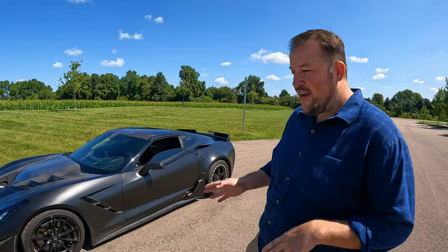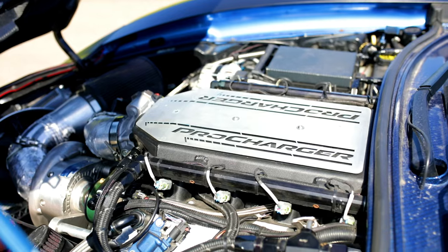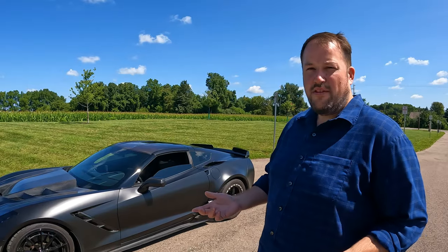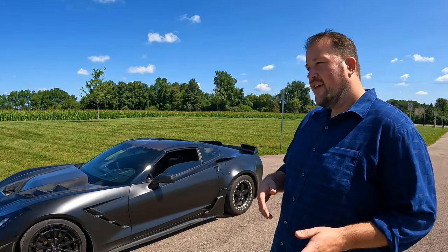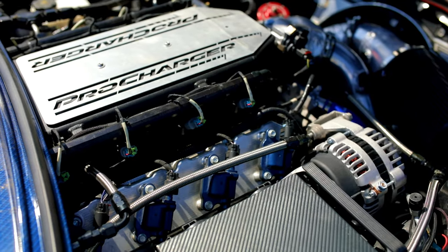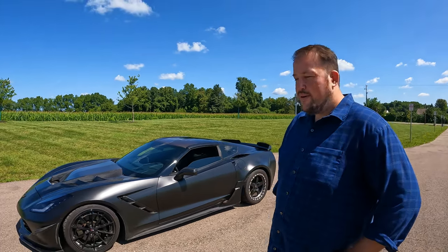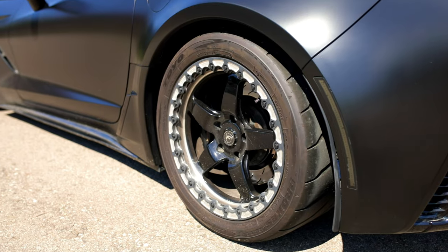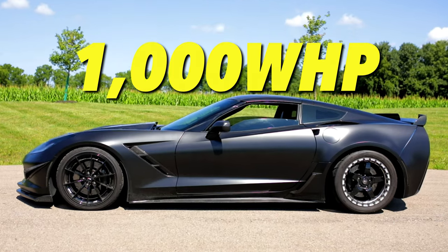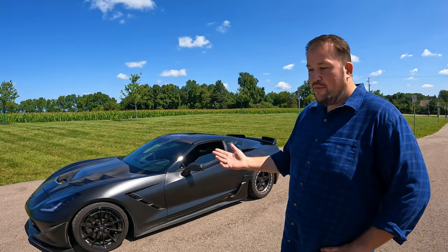It started as a 2014 Stingray. He ended up tearing the entire car apart within two months of owning it — swapped the engine out to a fully forged engine and went with a ProCharger. When the build started it was roughly 700 horsepower, but he didn't have enough fueling to go beyond that. He converted to a ProCharger intake manifold with a second set of injectors — there are actually 16 injectors in this thing, a triple fuel pump, and a full return system. It has enough fueling to make about 1500 to the wheel. He's maxed out the F1A ProCharger and it's currently making about 1000 to the wheel. Eventually he'll switch to an F1X and go for 1300 or 1400 to the wheel.